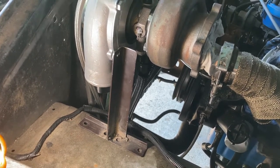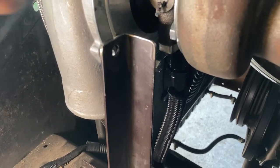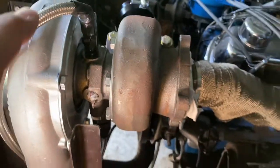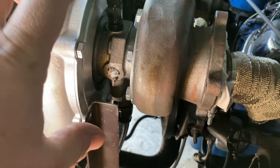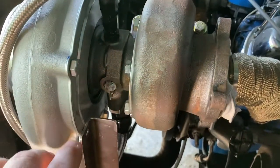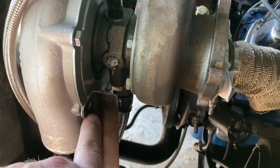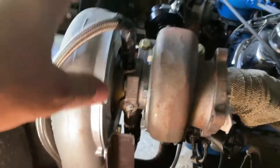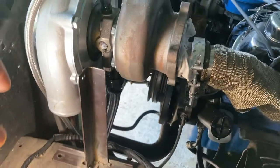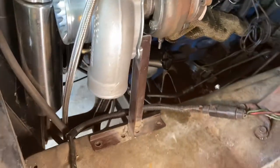She's all welded up. As you can see, I did it to where it supports on one bolt — you might ask why not two, and that's because I've already displaced this turbo at its lowest point, where if there's any friction or pushing down, this is as low as it's going to go. I'll bolt it in, press down a little bit with the weight, get it cinched down on all four bolts, and then we'll have a proper sturdy structure to keep that turbo supported.